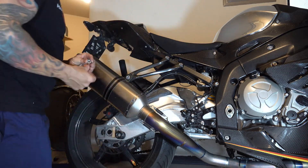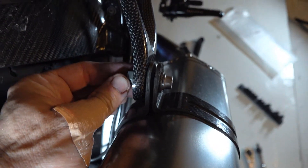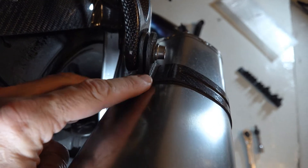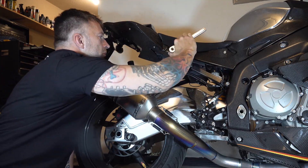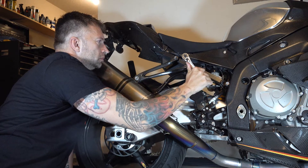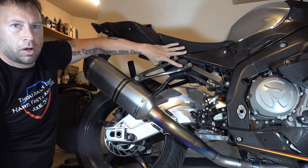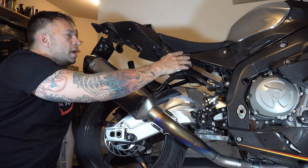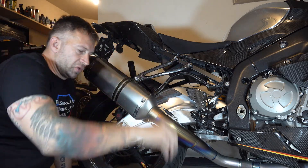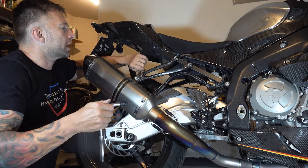Assemble this the same way. On this connector you've got a bolt coming through and a nut that's going to go on the back side. You have your bracket and then the two pieces of this part coming around it. There are some metal shoulders in here, but this is carbon fiber so don't over-torque it. Get them snug, but you don't have a passenger foot peg here anymore so it doesn't need to be as tight as before. No need to crush everything and crack your carbon fiber — just get it to where it's good and snug and not going to vibrate loose.